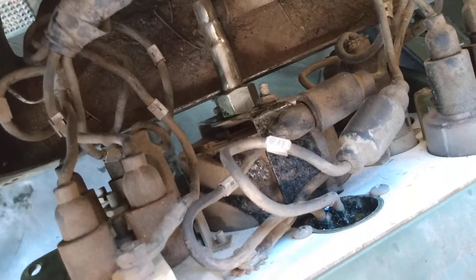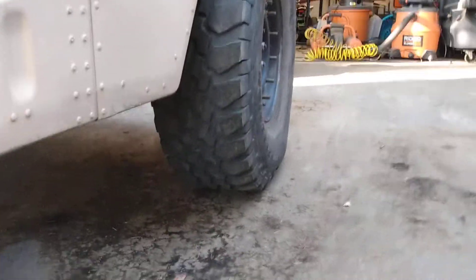But today it's not spinning, so that means I've got a problem down lower — that's going to be at the transmission, or it could be a bad cable. On other Humvees I've had, and this one's no different, it's going to be the cable. I'll show you what it looks like down underneath and how you troubleshoot this Humvee.